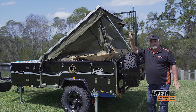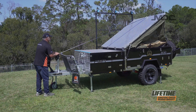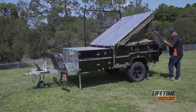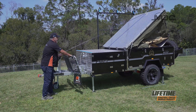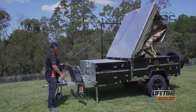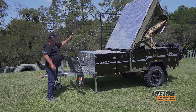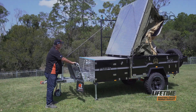I'll take up the slack on the winch before I take any load off this, then come and remove the spreader pole so it doesn't fall and chip the paint. Now as I winch this open, I stand away from the line of the strap. If the worst happens and there's a hardware failure, the amount of stored energy in this strap is quite high — it will come back at quite a speed. So I'm off to the side in a safe place.